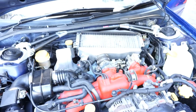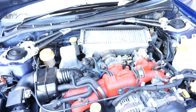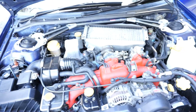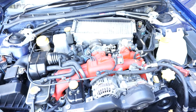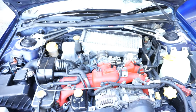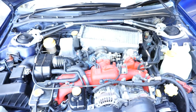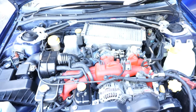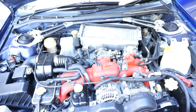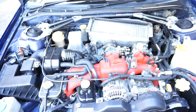So this is the engine bay. It's pretty much stock. I forgot to mention one thing, and I'll share that gallery with pictures. The ECU in the car is from a UK company called Enduring Solutions, and what they do is they sell a daughter board. They can send it to you, and you can solder a chip bed in and then put the daughter board on that chip bed, and it basically turns the standard Subaru ECU into a standalone. And you can run the MAF, or you can run map sensor.